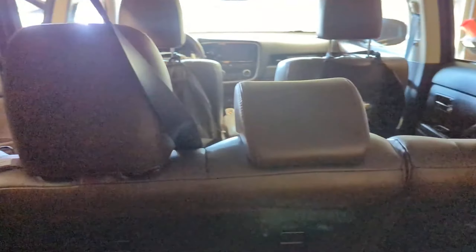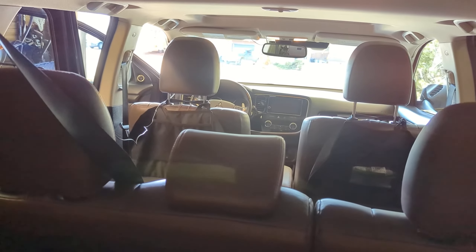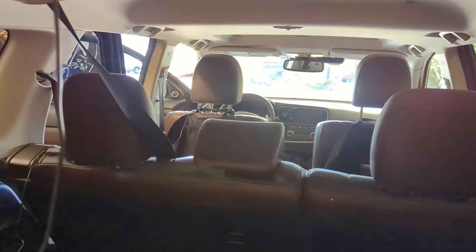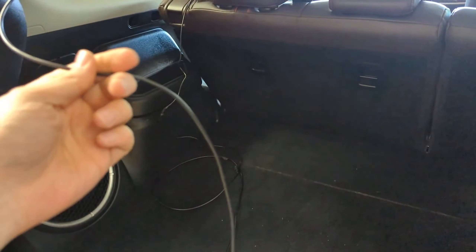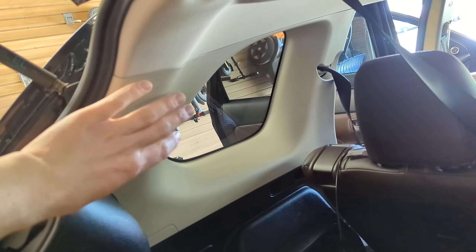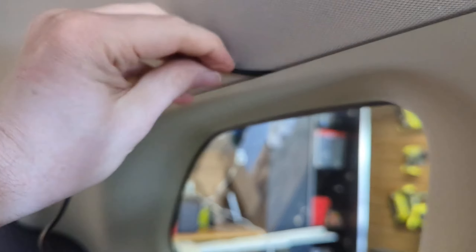For this rear dash cam, the cable is going to go all the way to the front. What I've done is mocked it in — I tacked one end and pulled it along, moved on to the next point, and got an idea of how much slack is going to be left over. The concern is you don't want it dangling back here or up front. I'm going to start at the front and start tucking it in along the trim, and back here I think I can squeeze a lot of the excess down into these panels. Try to find those spots for excess before you start hiding the wire.